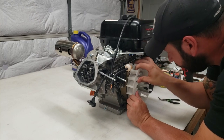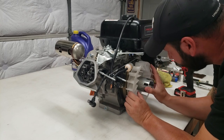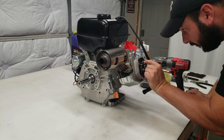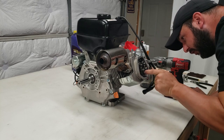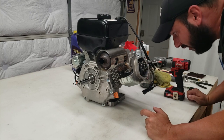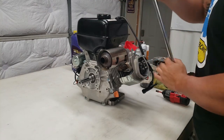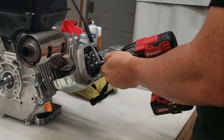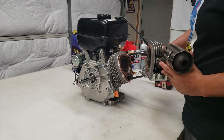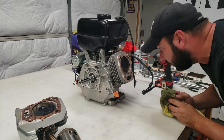The flywheel magnet is still on there, so that's good — that didn't come undone. Coil gap still looks good. I'm just checking the flywheel to make sure we don't have any cracks in it — that looks okay. All of the rockers look good; this has roller rockers in it. Push rods are still in place, nothing up here looks out of place or broken, so the head may still be good. Let's pull it off and see. Head bolts are all still torqued down, so that's good.